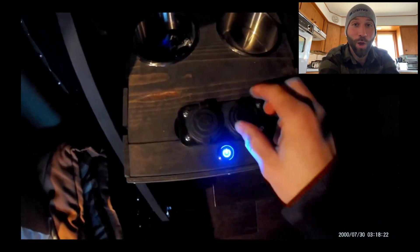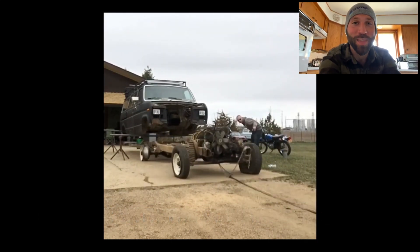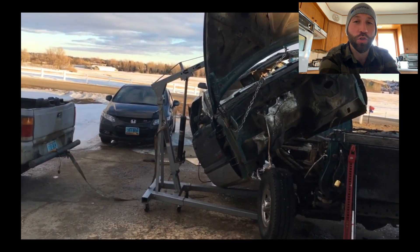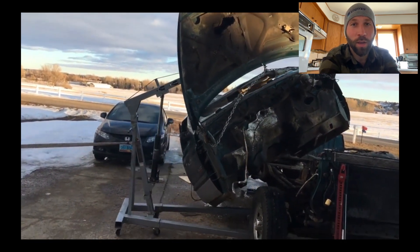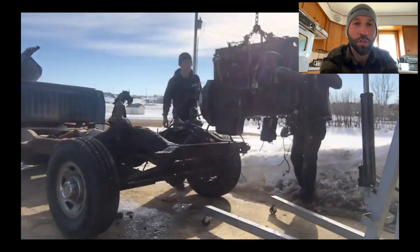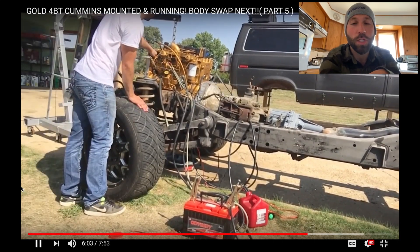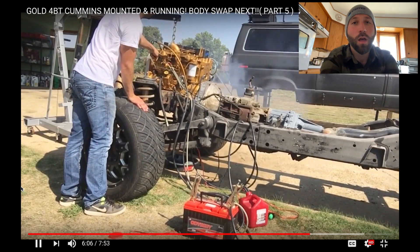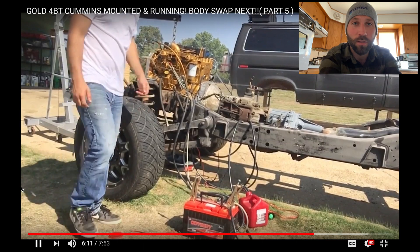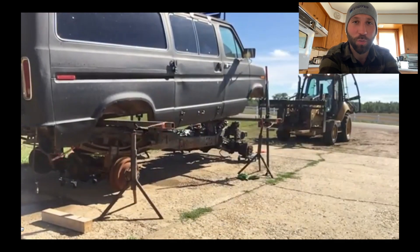I said no... okay. So that's where things really took a turn. I pulled the body off the original chassis, bought a rolled 1999 Dodge Ram 2500 truck, pulled the body off that as well, pulled the 24-valve Cummins engine out, and did the body swap onto that chassis, also building a 4BT Cummins diesel engine for it. It took quite a while to fabricate everything and connect point A's to point B's and make things work feasibly for a trip.